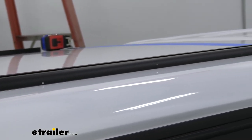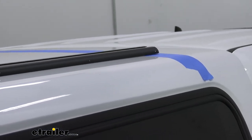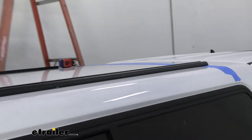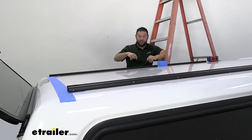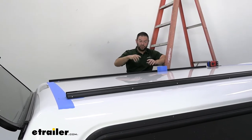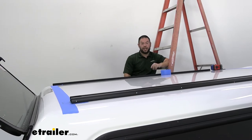When you do go to drill, every camper shell has a gel coating. You don't want to just straight up drill through that — it could spider web crack on the top. I suggest using a countersink first. That's going to make a little divot, and then once that makes that space, you can drill through without worrying about cracking anything on top of your camper shell.